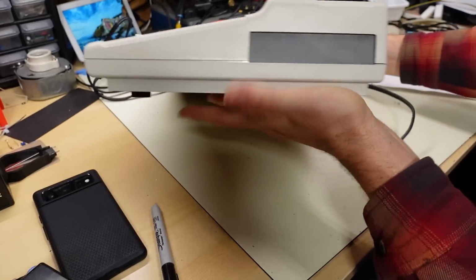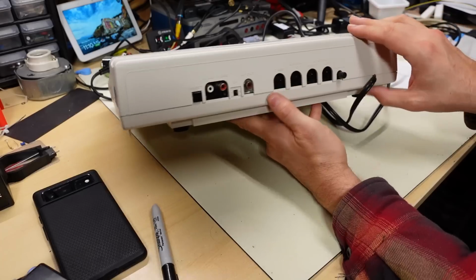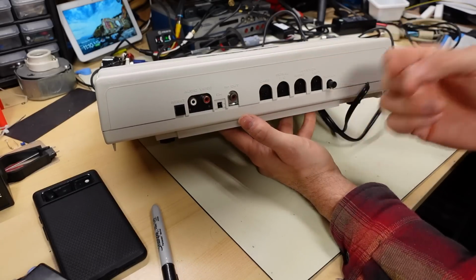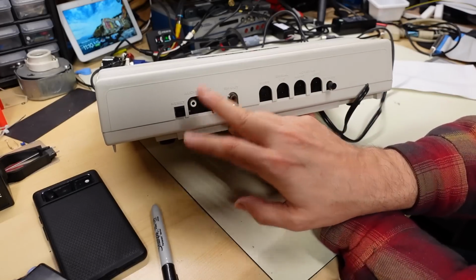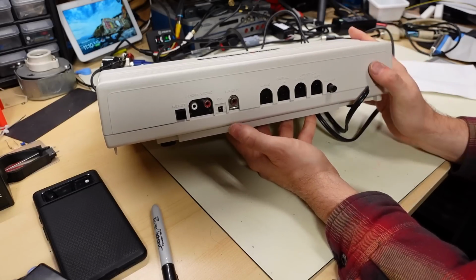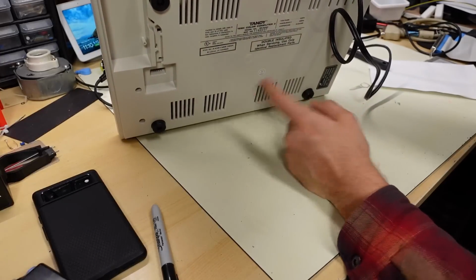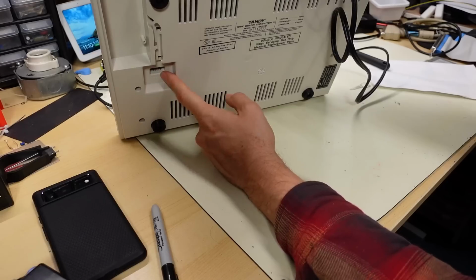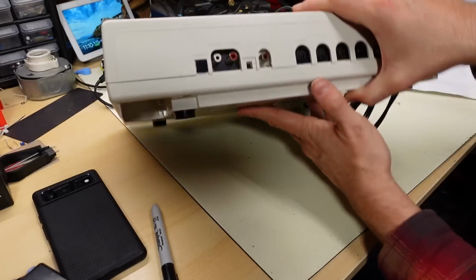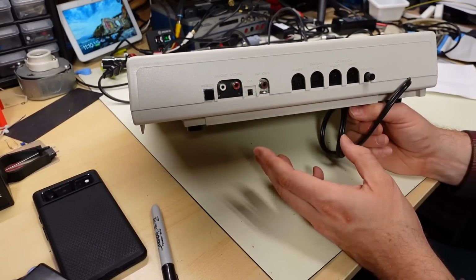We have the cartridge slot on the side there. And of course, the TRS-80 Color Computer 3, the big difference between this one and all the other color computers, the original one with the gray case, and then the 2, is that it has composite video output and an audio output, so it's not just RF. More importantly, it's not any faster, but it supports additional graphics modes because on the bottom here, it has an RGB connector. Now, it's not the easiest one to use, but it's basically just like an IDC header. That RGB output, along with the composite output, gives you 80 column text possibility.